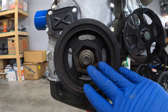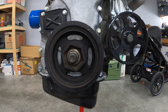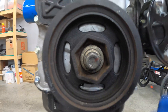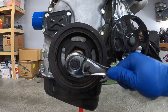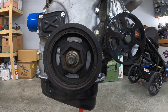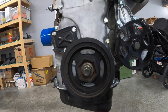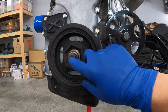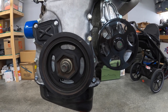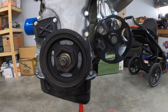So I went to 36 foot-pounds and then the max my torque wrench goes to is 150, so I torqued it to 150 and only got to about 45 degrees. I then added another push with a bigger wrench and extension and got a few more degrees out of it. I'm going to leave it there — I think the red loctite will help. This is a clockwise rotating motor unlike the B series. I followed the steps in the manual: putting a little oil on the back side of the nut so the bolt doesn't create friction against the washer, but because we put loctite on the threads I'll use that as my lubricant. This is tight.